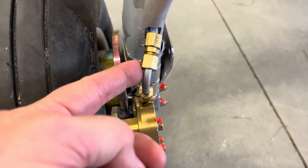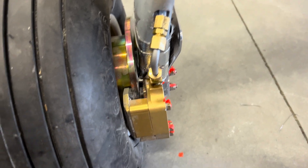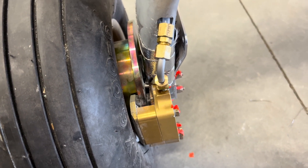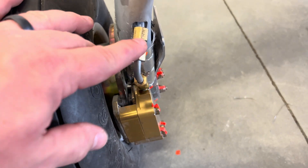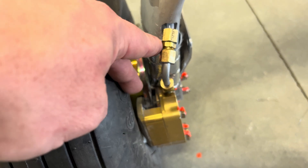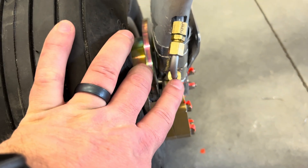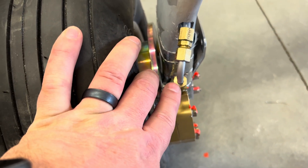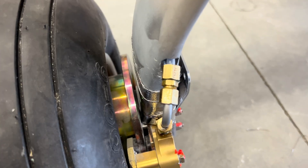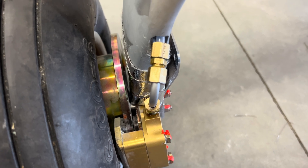I thought that just extending this up a little bit — which I was going to have to do to accommodate the bigger brake rotors — was enough, and I think that'll keep the heat away because the plastic nylon brake line is up in the gear leg, pretty protected. Initially when the nylon was coming all the way down here, people were having it leak because it would get soft and melt. But keeping it all the way up here, I think I'm going to be okay. Time will tell on that one. Anyway, that's the update for today — thanks for watching.